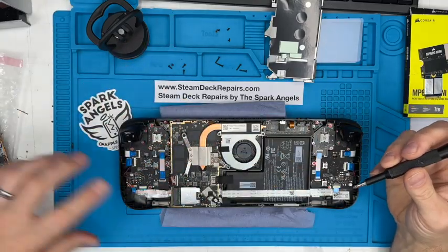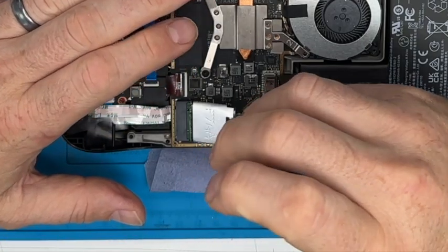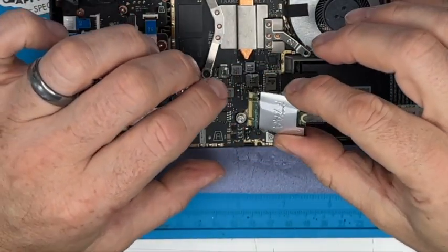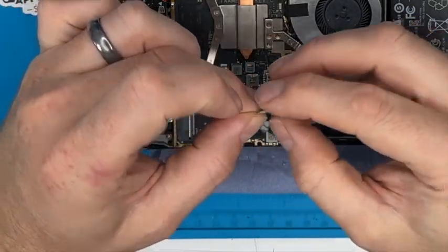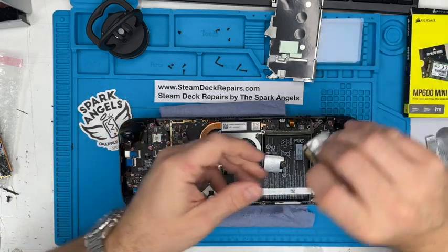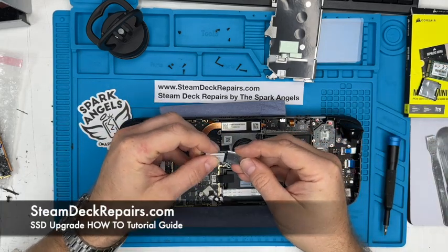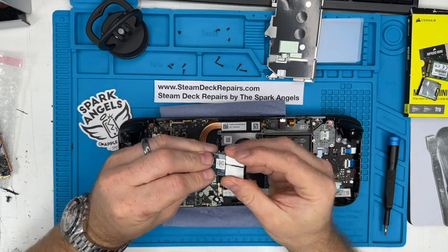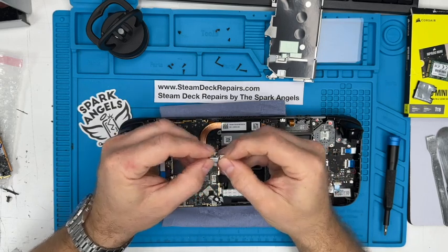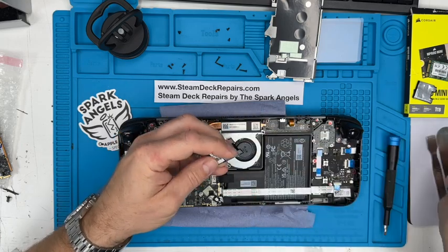We're getting back to the SSD change. The large screw at the bottom of the SSD — we're going to unscrew that and it automatically pops up to about a 30 degree angle. Put the big screw out of the way. It just lifts out. Nice, quite a bit of space under there. If you're doing an SSD change — which I am — I would always normally keep the thermal shield on. Normally when you get an SSD they don't have these shields on; they come to you bare. So you would always transfer the shield from the one you're replacing. This is my 512 and I'm just going to slide that shield back over.